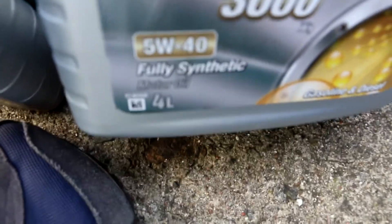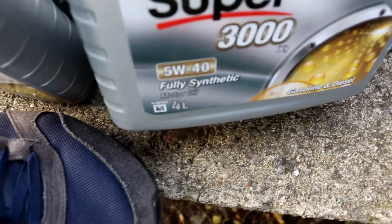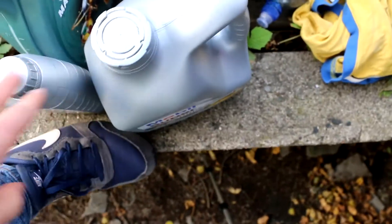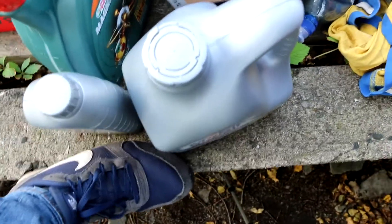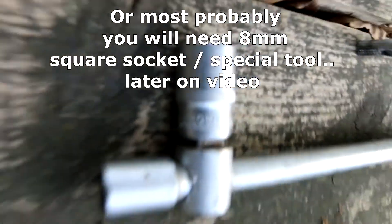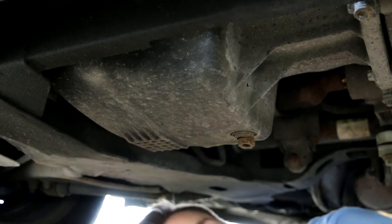You will also need some engine oil. I will use 5W40 full synthetic, but you can use other synthetics as well — 10W40, 10W30, or 15W40. It actually works with different sorts of oils. You will need around five liters for this engine. It's a small 1.4 engine but it's 16V, so it has quite a capacity — a bit over four liters. You'll need some container for the old oil. I'll use this can and a five-liter bottle together. To access the engine oil drain plug, you will need a 17mm socket.